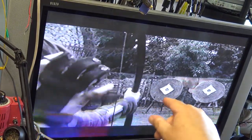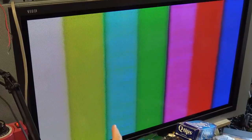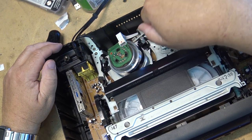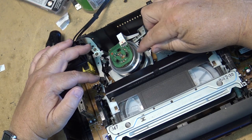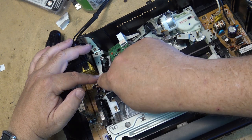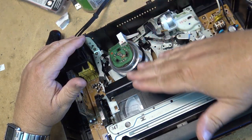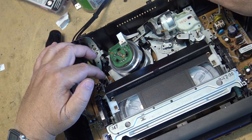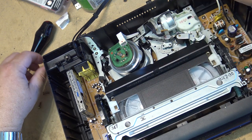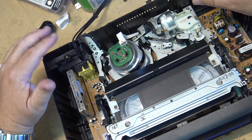This is my recording test tape — it has Game of Thrones on it, so I can't leave it on. This was a tape I used to demonstrate what happens with macrovision, and also to demonstrate the erase head — specifically the delay when starting a new recording. Because the erase head is positioned before the head drum, when you start a new recording there's a delay from the time the tape travels from the erase head all the way around the drum, which is why you see color bars flashing before the picture clears from the top. This tape was to demonstrate the effects of an erase head that wasn't working, but it's one I can record on.